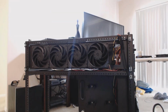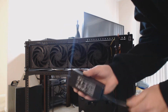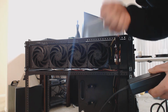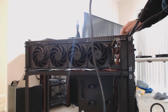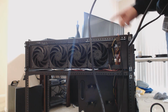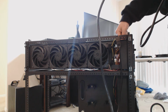So this right here is a connection going all the way to my wall. Let me pull this up so you guys can see. It's made by OK Gear, and it is, like I said, an adapter that plugs into the wall and goes into a 4-pin Molex, so you can test your pumps, LEDs, and anything like that before installing. I have this hooked up to the fan controller here. From that fan controller I have Y fan splitters, so pretty much, except for one, unless I get a fan from my motherboard tray, there are 2 fans on each channel. There are 8 channels, 30 watts on the FC8.